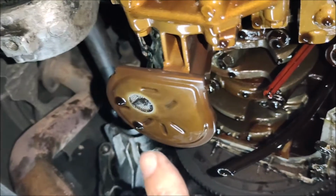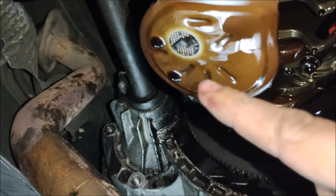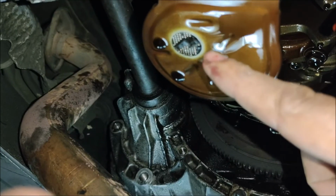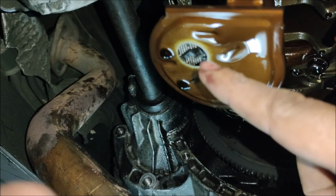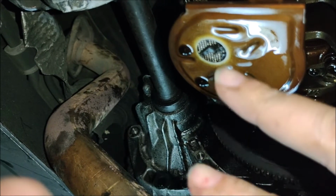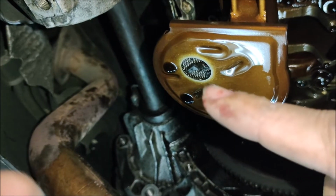We'll open it first. So here's the strainer of the oil pump. For me, the design by Peugeot is very questionable, considering there's only a small screen area on the strainer. Being very small, it can easily get clogged by debris, just like this one. Unlike other cars, where the screen has a large area, this one is very small and can clog the oil pump so easily.